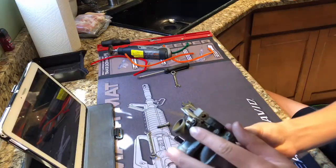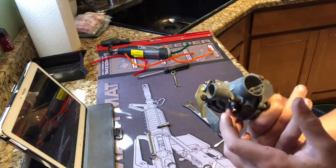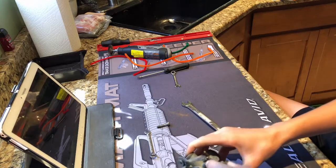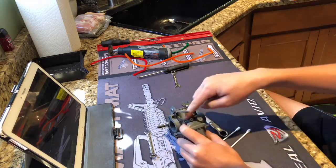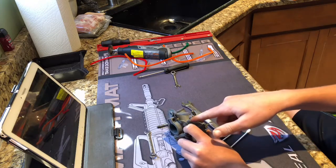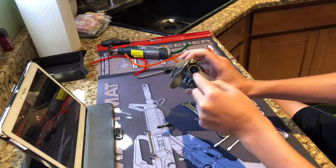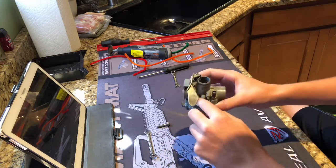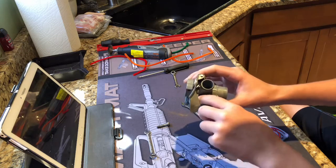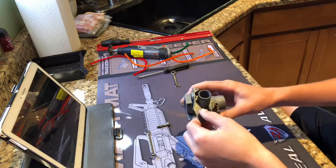I got the choke mechanism all cleaned out. I did that off camera also. But I found the screw settings. So that's our pilot air jet. And then this is our throttle stop, because that's why it sticks out down in there. So that you have to adjust when the bike is running. So you only adjust this one right here, and you gotta make that one 1.5 turns.